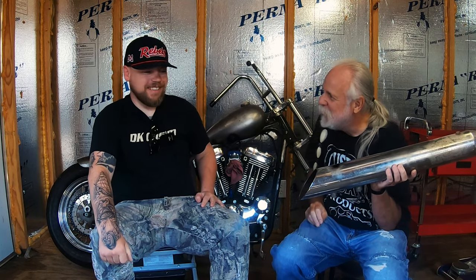So if you've bought some inexpensive mufflers off eBay or Amazon and you can see that they are pretty thin, go buy some fender washers. For those of you buying knockoff cheap pipes, you're going to have to spend a little bit of money and get a fender washer — a much larger washer. You can see the difference — that larger surface area spreads the tension over a wider area.